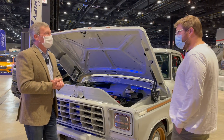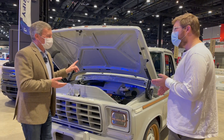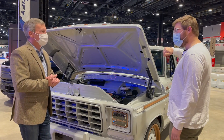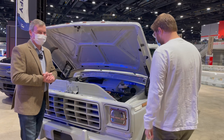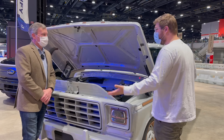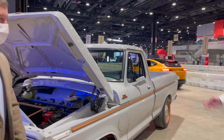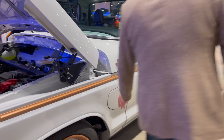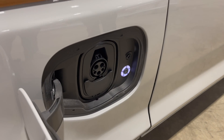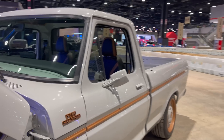You also had to run a drive shaft all the way to the rear. It's a single gear — just put it in D on the shifter, and they use the same Mach-E gear selector. There's a 12-volt system and a high-voltage 400-volt system, all really nicely done. The charging port — this vehicle doesn't DC fast charge; it has a regular Level 2 port, but it can roll up to an Electrify America station. We've got to do a charging test on this one day.